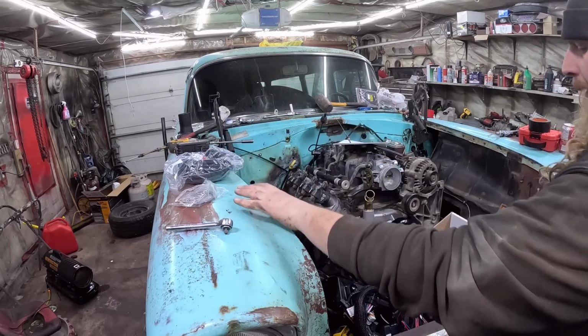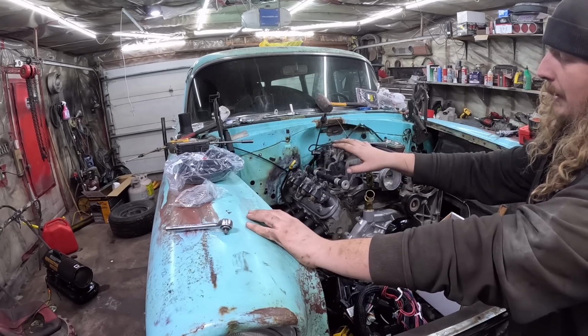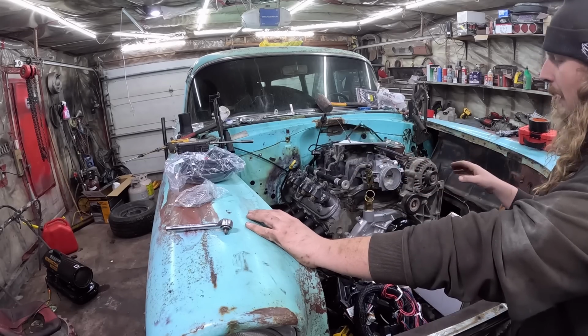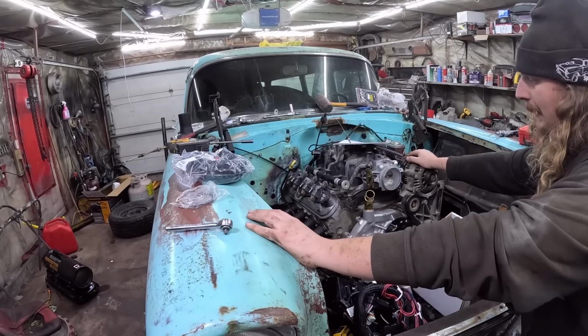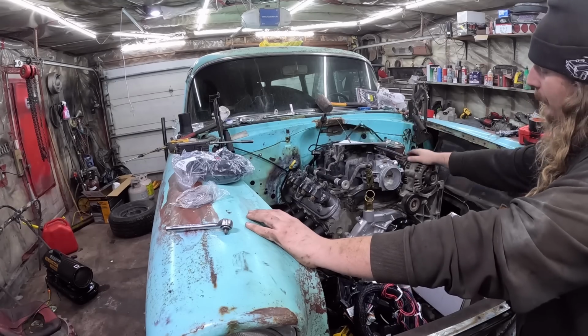So you're going to have one power ground right to the battery direct. It is fused, so you're dialed in there. I think then it wants like a 12-volt switched, and there's a couple of grounds that have to go right to the cylinder head. It was very particular about that. In the instructions, it says to the back of the cylinder head.